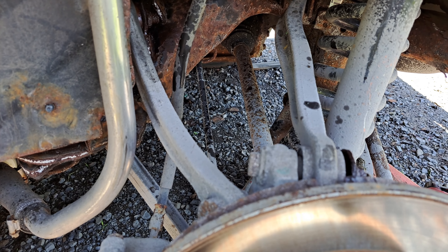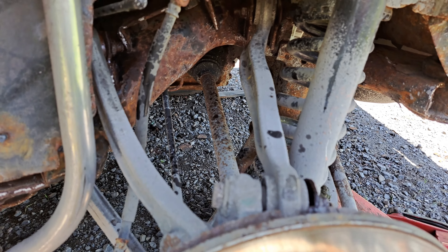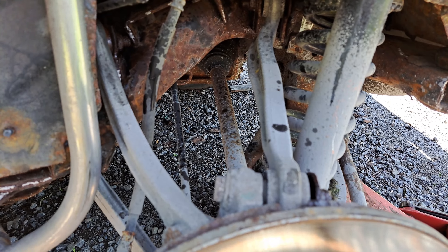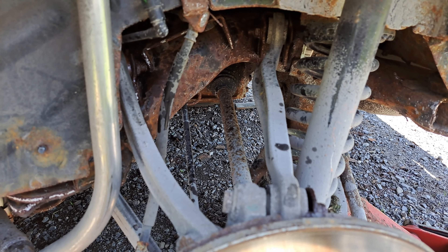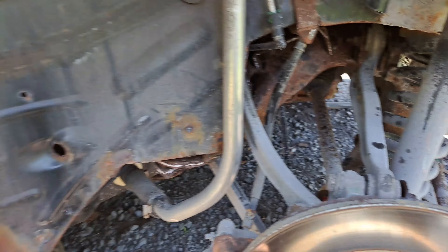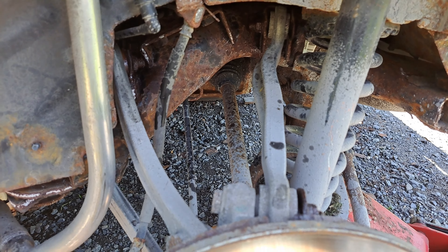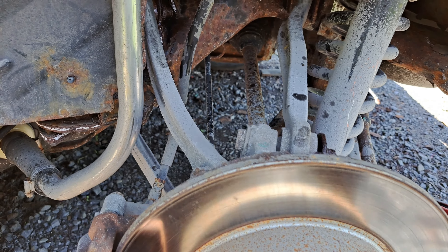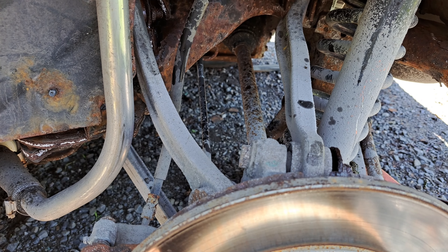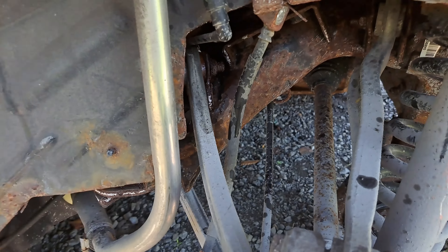It's time to take a look at the rear suspension on this Chrysler 300. This is the main reason why almost no one runs these cars — the independent rear suspension with all aluminum control arms. Basically every single one is aluminum. On the first car I raced, I never swapped them out and they all broke like toothpicks, leaving the wheels flopping around. Never broke an axle, but that's the main reason no one runs these.